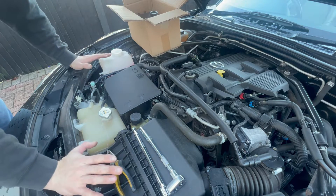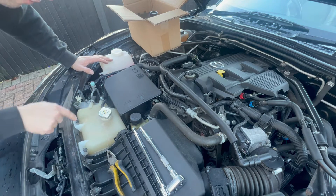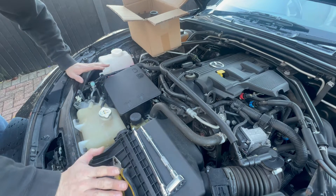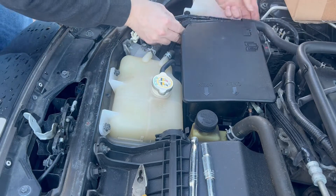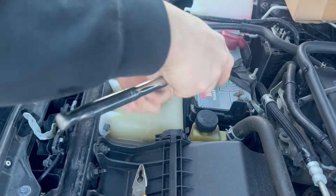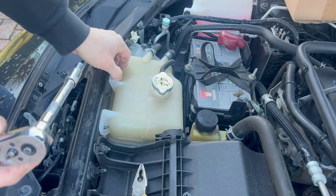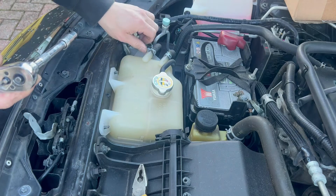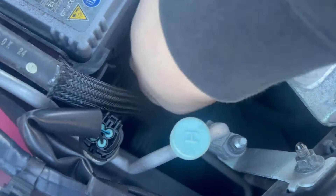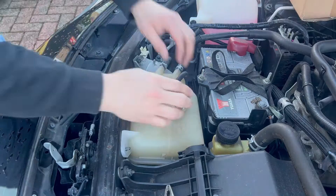So the untouched engine bay of an MX-5 — all you need for this is to take those three off, which are a 10 mil and M6, and you'll need some pliers to undo these clips. Now we can remove the hoses and the battery cover with a bit of a wiggle. Loosen off the three M6 bolts that hold the bottle in place. The furthest away one in this shot is on a bracket — undo that bracket as well, it'll make things a lot easier when getting your old bottle off and your new bottle on. There are a couple of hidden hose clamps down the back to open up and then we can start removing the top hoses.